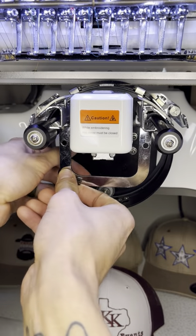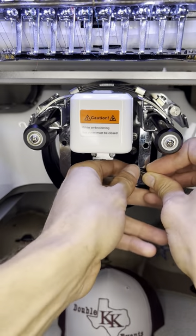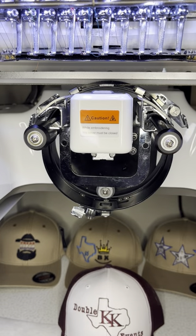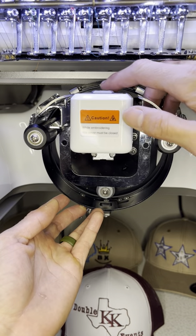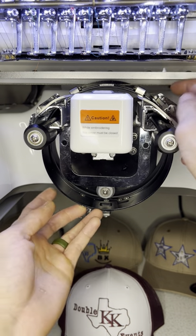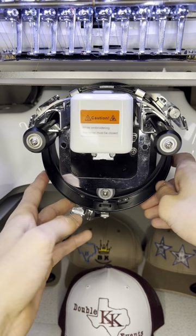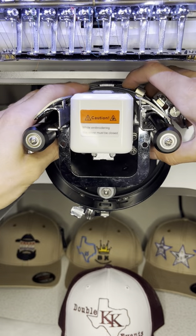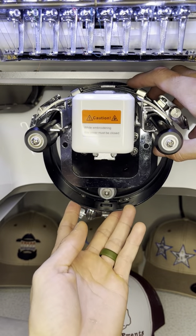They're a little tough to get to, but you've got a good enough angle. Mine's not long enough to go straight in — they won't reach — so I come off to the side and go in at an angle, and you still have a good enough angle to tighten and loosen it right there. Once you've got it loose, what you want to look at is this gap right here in between the black piece of the cap driver and your arm. You can now drop your driver down to that arm, and you want to get as close as possible — a hair away from it would be perfect, otherwise you'll scrape your arm.